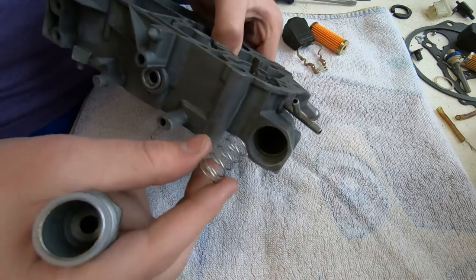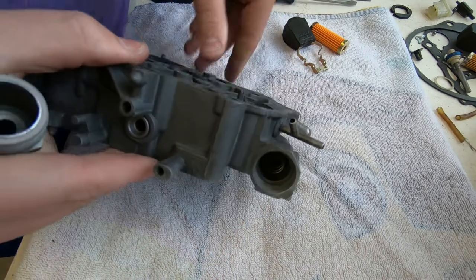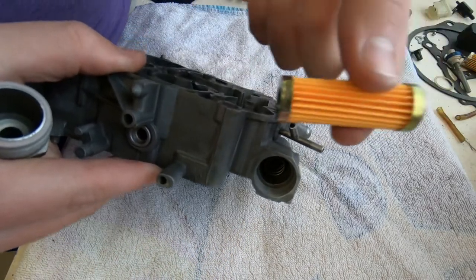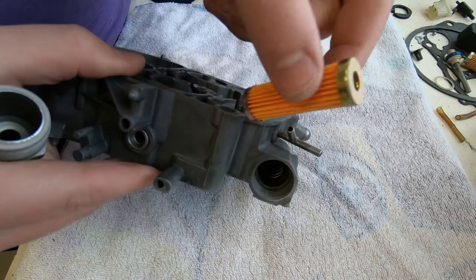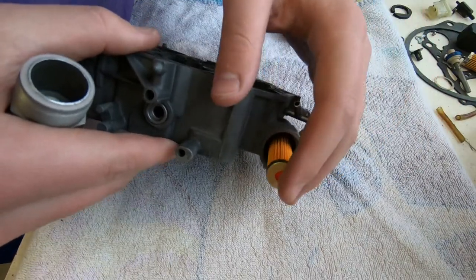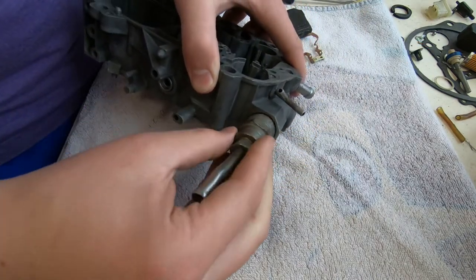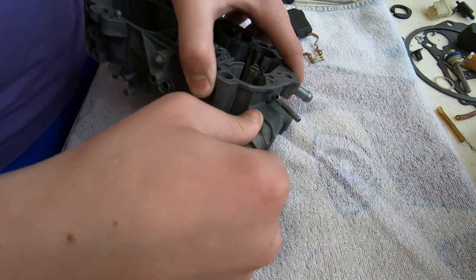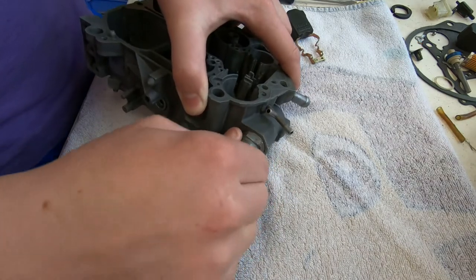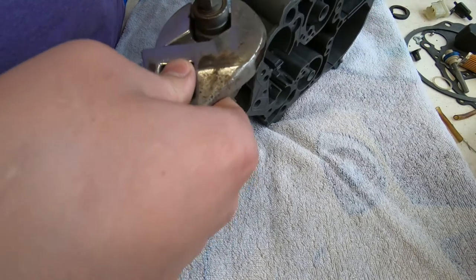It's spring first, then fuel filter with the open end pointing out of the carburetor. And the one thing that you need to know is there's a little black check valve that we did not install in this filter the first time, as shown in the video, but later we changed our minds and we did come back and put it in because it serves a useful purpose. It keeps gasoline from working its way back out of the carburetor.